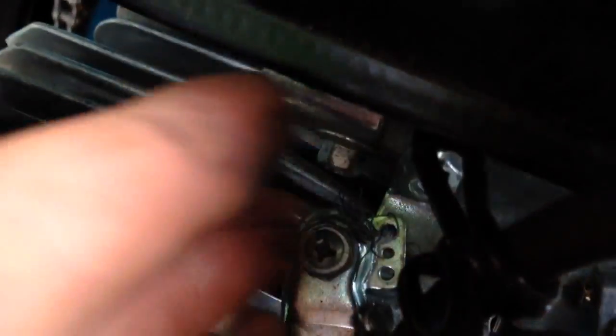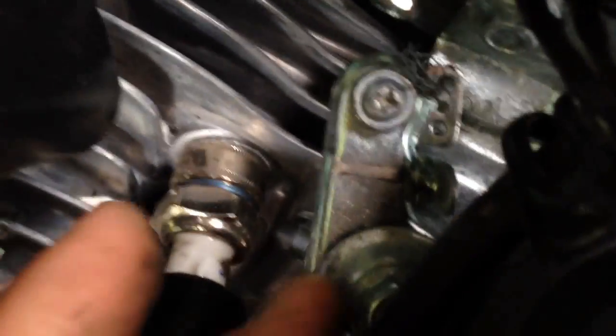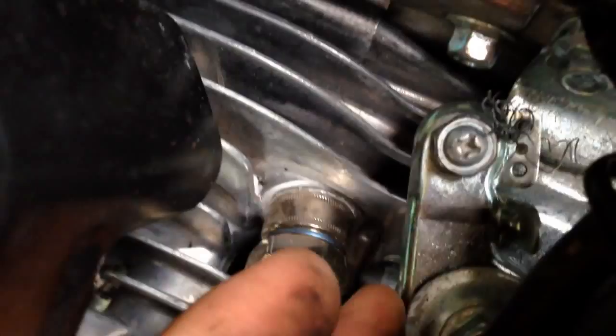But yeah, the throttle assembly is right here. It's basically this lever right here, and then you put your throttle cable right into there. When you pull the gas pedal, it pulls this, which then makes this pull. And you're gonna want to loosen this because it's a friction thingamajigger, so it basically stays put. But if you loosen it up, then it'll easily move.